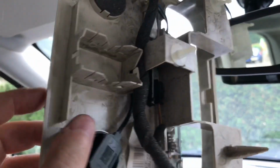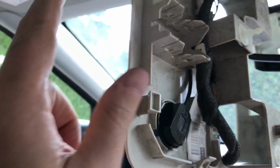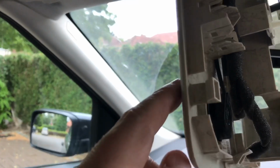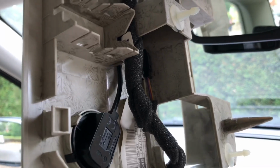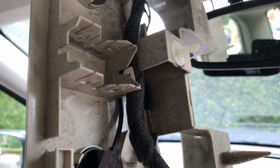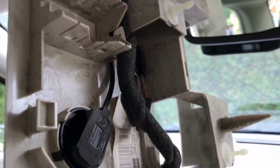So what I'm looking to do is to have one extra wire that comes off 12 volts here and runs down that pillar and somehow finds its way to the amber lights. Could actually go across here, down this pillar and through and back up the edge of the windscreen. And then for the main beam, because that's actually fed the relay that runs the roof lights, is fed from the main beam feed to the headlights, I think I'll actually need to bring that up to the button and then back down again.